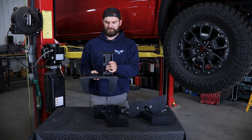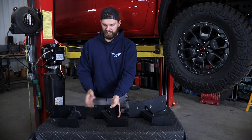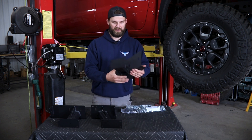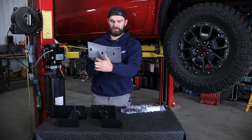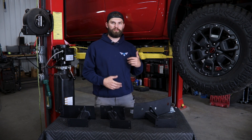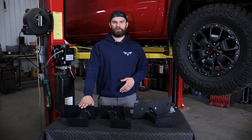Those aero cutouts are going to be forward facing, so point them toward the front of the vehicle. This one here is the front leg — you can identify it by these two inward legs as it's mounted on the vehicle. Here's the center leg, similar style without those two little wings, and then the rear leg which mounts to an angled-up portion of the frame, which is why it has multiple flanges on the bottom end. If your vehicle was equipped with a factory step or rock slider, those will need to be removed before these sliders can be installed.